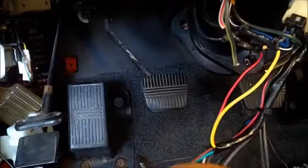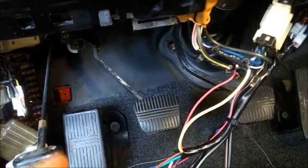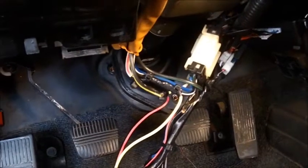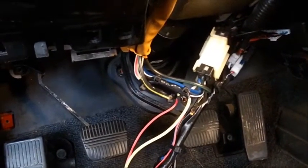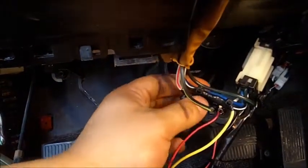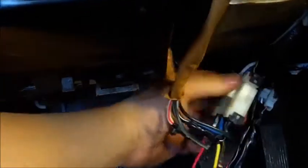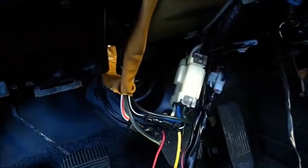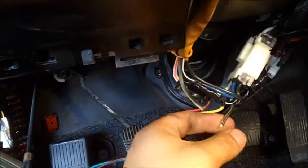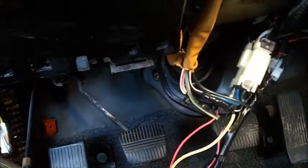Now I'm going on to the starter kill — the starter wire does need to be cut. I did test this one the same way, but this wire only gets voltage during cranking, so you'll see 12 volts while the vehicle is cranking over. To double-check you have the correct starter wire, you can try cranking the car over. Also, depending on where you're getting your wiring information, the colors can be different from one side of the junction to the other. That's why it's very important to actually test your wires. Keep in mind the wires are different on each side, so a black-yellow on one side doesn't match the black-yellow on the other.